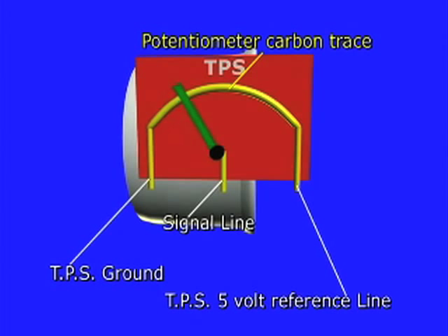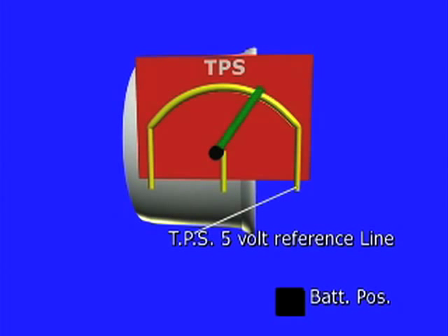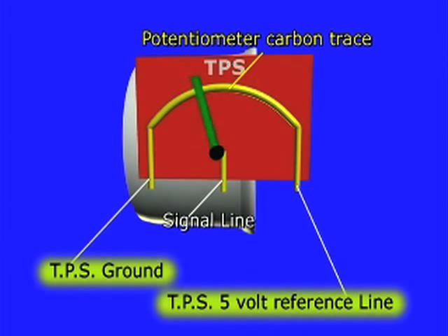In order to test the TPS ground, you need to remember three main test points: the TPS sensor ground, and the battery negative and positive terminals respectively. A second set of test points to remember are the TPS 5-volt reference line and the battery negative terminal. By measuring the voltage at these two points, you can safely assume that the ECM is providing the 5-volt reference. The TPS ground and the 5-volt reference line are both needed for the TPS to function properly, and all kinds of drivability problems may be present when the faulty issue is with one of these two lines.